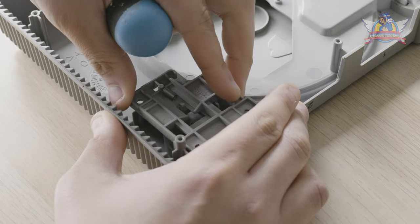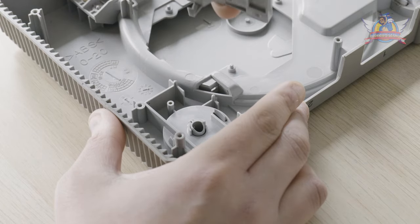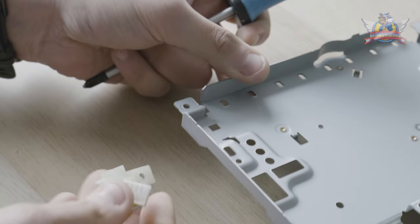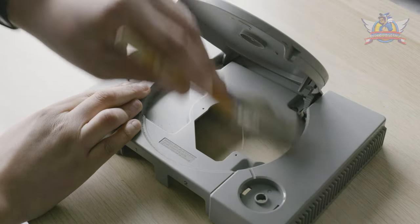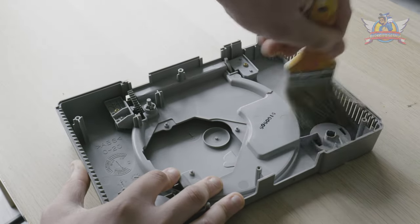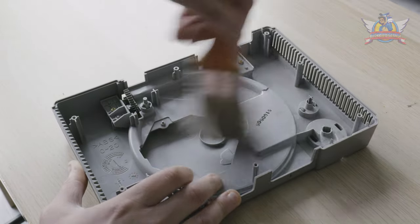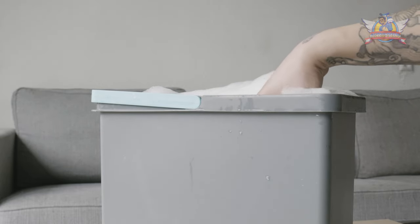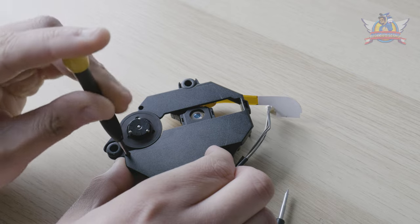The eject button isn't functioning properly, so I take out the unit as a whole for cleaning. Off comes the bracket that holds the power cable. I thoroughly clean the unit with a brush — doing this before the plastic components take a bath so that most of the grime gets unstuck beforehand. The bath consists of mildly hot water, cleaning detergent, and anti-grease.